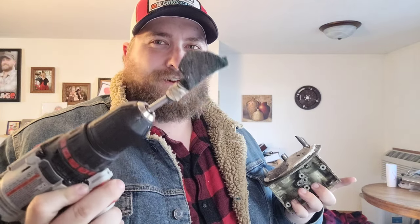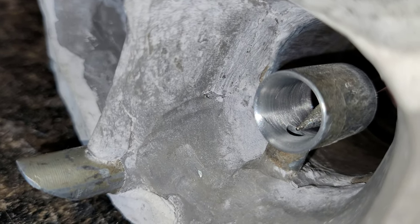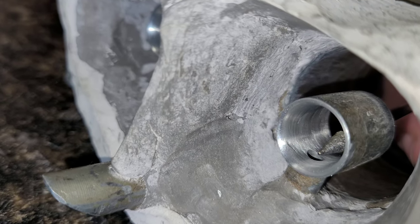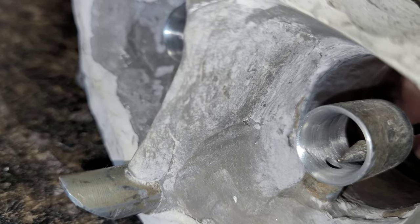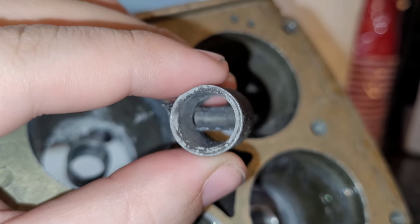That's one possibility, but it's a little trickier to do with the tools I have on hand. I made this contraption with a Scotch-Brite to help polish the boosters — I don't have a machine shop. Another possibility: once I flare out the bottoms of all of them, I could come in to the bottom of the fuel hole and make a little V-groove notch for the fuel to come flowing down before it hits the air, giving it a place to go before it actually enters the air stream.